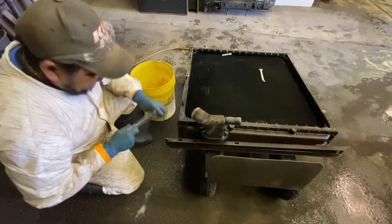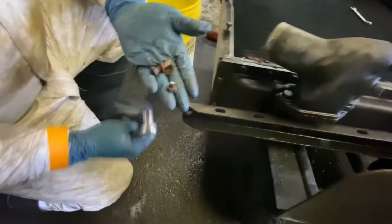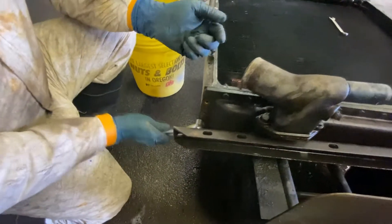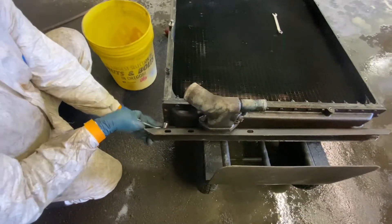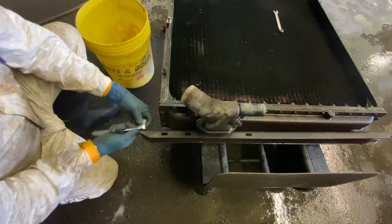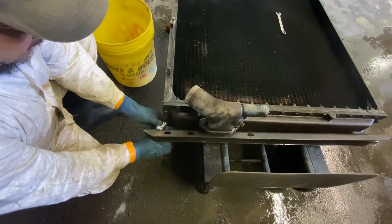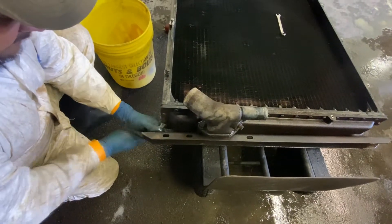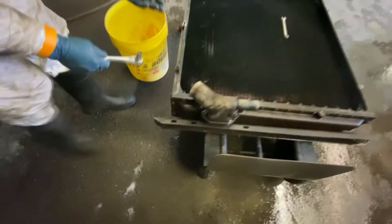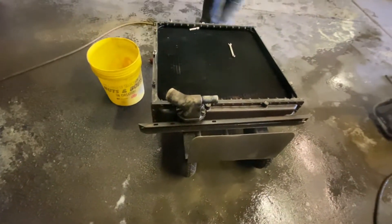That one you have to be really careful — see how rusty it is? Did it break? Yep. You're gonna have to drill that out. It's breaking in the aluminum. This is maybe why the other shop didn't touch it right here. It's pretty hard working with aluminum and steel together — every time steel and aluminum meet they kind of meld together, so it breaks easily.